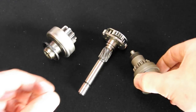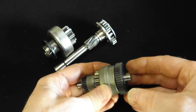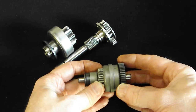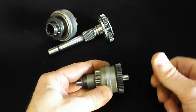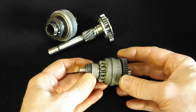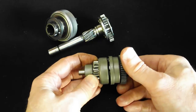Very briefly, let's look at the idea of a Bendix gear - a method of getting the mesh of the starter motor into or away from the crankshaft, because once the starter motor starts and the crankshaft starts spinning, you don't really want the sudden speed of the crankshaft being fed back into the motor. This is a Bendix gear, it's come off a little RS125, typical in small capacity engines and scooters.